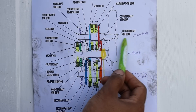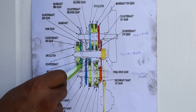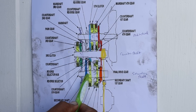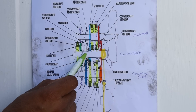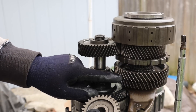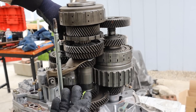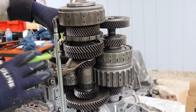Let's go through the power flow diagram for second gear. The engine spins the input shaft through the torque converter, bringing power to the gear at the end which goes through third gear — free spinning — to power the secondary countershaft. The secondary shaft is splined to the clutch, so once you engage it, the clutch and gear lock together. That gear transfers torque back up to the countershaft which drives the final drive. For reverse, it's a small gear driving a small gear driving a larger gear, with a ratio very similar to first gear. Honda basically automated a manual transmission — I do have another video on how the hybrid version of this transmission works.